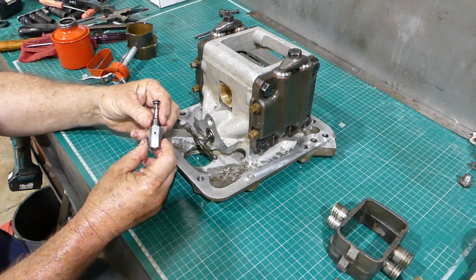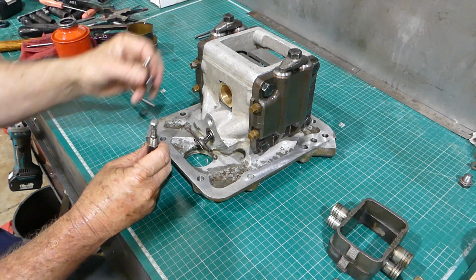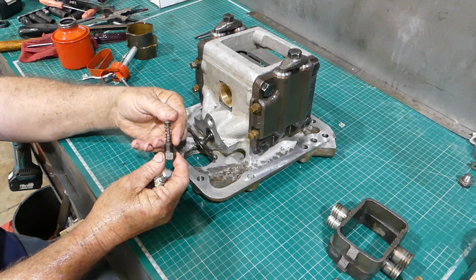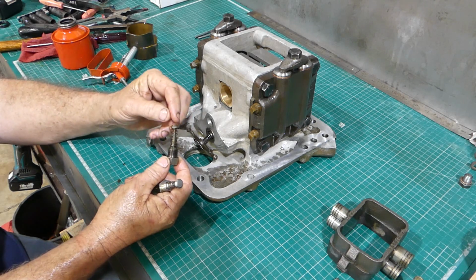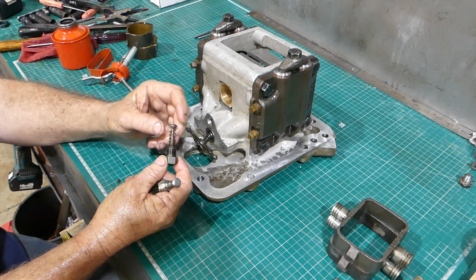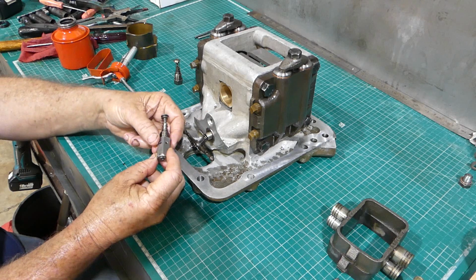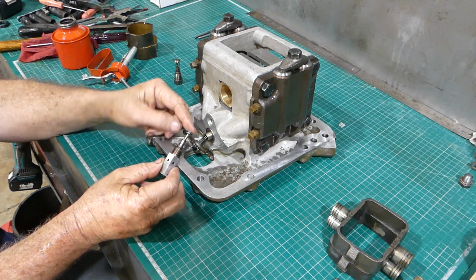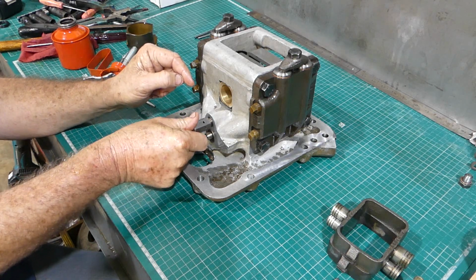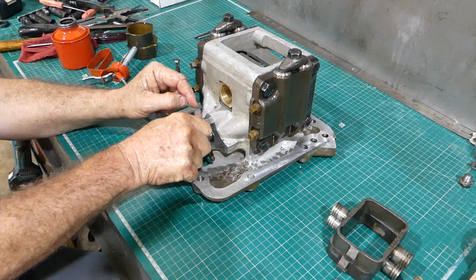All right, now the relief valve. This hasn't got a reading on it, but a new relief valve comes with the kit, so we are using it. Now that fella there, I can't remember when they all changed, but I'm not sure where this one relieved from. So this sits in a seat, and when it reaches a certain pressure, it'll have a bit of oil in behind here helping it. It lets it go, and when it lets the oil out, it'll spray it out through here. And look, that's okay. On some of them, they actually put a little guide there to stop the oil stirring up the oil in the bottom. On ours, we're not going to have all that trouble, because it's going to be so clean, you could eat your lunch off it.